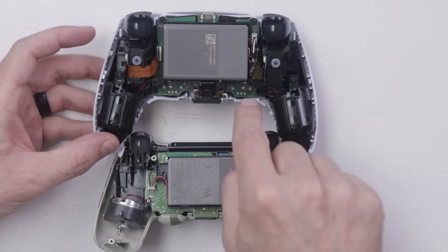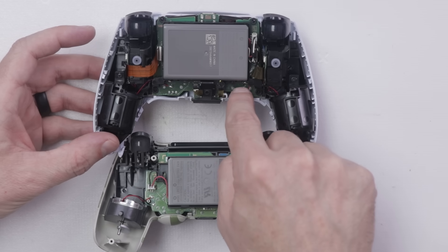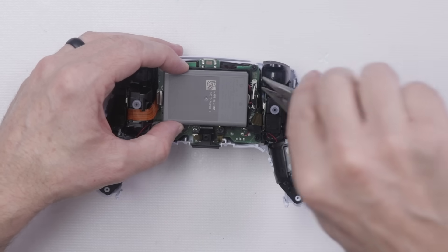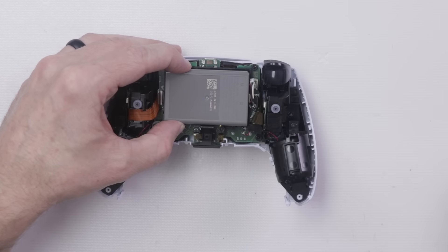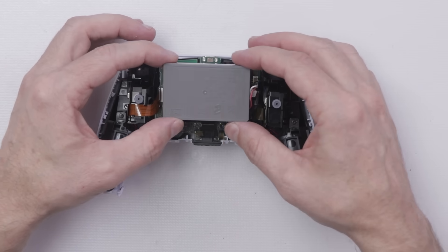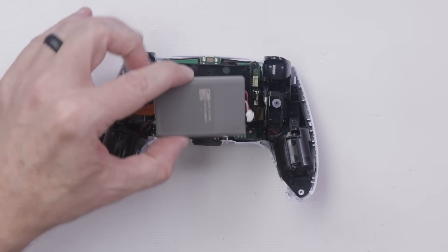While there's no way to know for sure right now, once we get a look at these analog sticks, we'll see if they're the exact same or if they look like they've been updated. Need to remove the battery connector right down here — I'm pulling on the connector itself, not the connector on the motherboard. This one also doesn't have any adhesive on it. Definitely a pretty big, beefy battery.